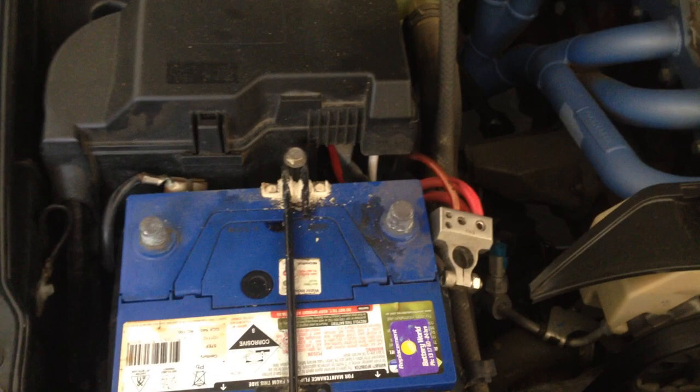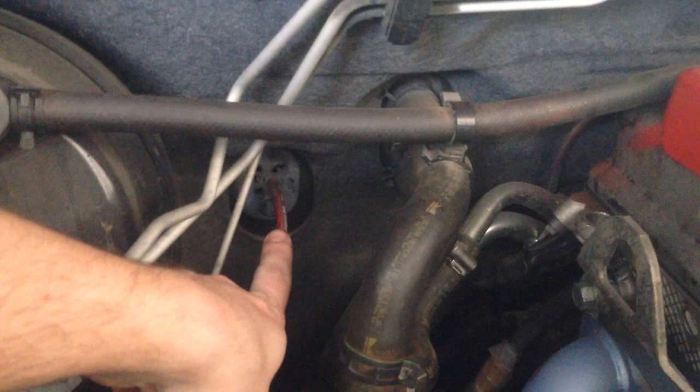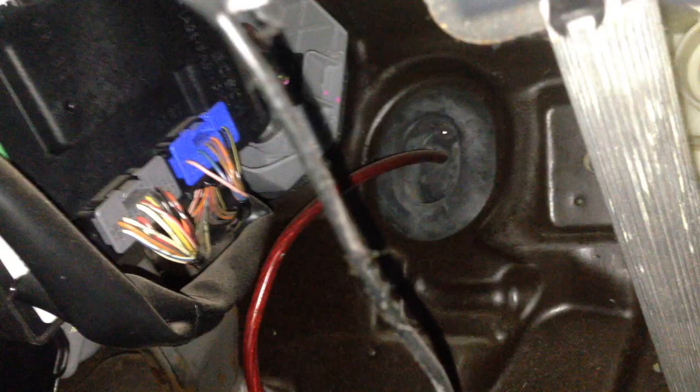The first thing you want to do is disconnect your battery and work out where your power lead is going to go through your engine bay. I've got mine running behind the fuse box, around the side of the coolant reservoir, and then using a little rubber grommet to get through the firewall. This comes up just inside the driver's side footwell, so I'll go around the inside of the car and show you that.